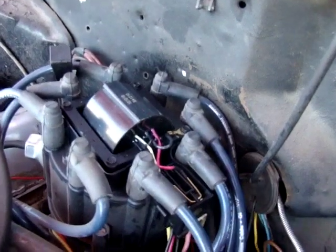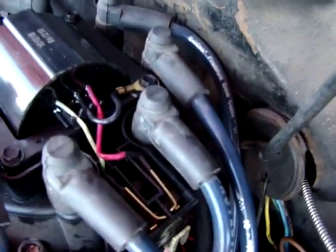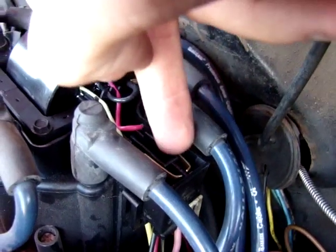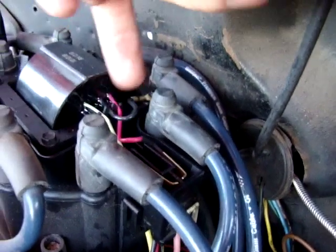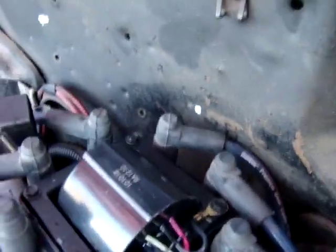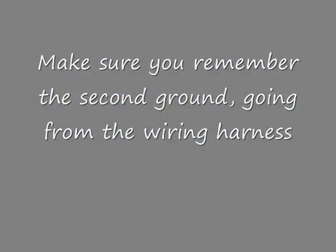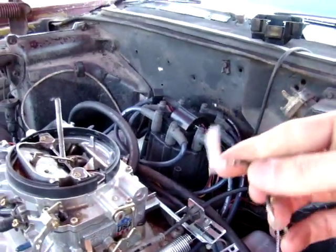Once it's bolted back onto the distributor, take the red wire first and just push it back down into the hole you originally got it out of — it should easily push back in. Red goes to the far right. Then unbolt one of the back screws and ground the black wire back to the coil pack, and take the yellow to the far left.